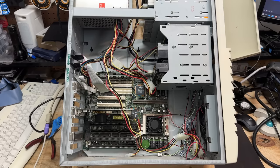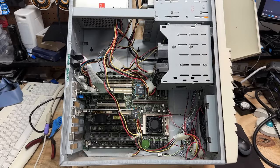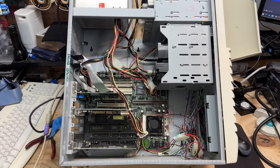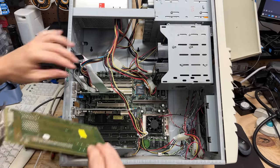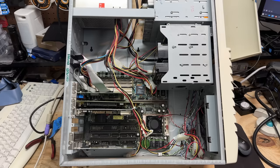I have a sneaking suspicion that it's the SCSI card — it could just be down to a dirty edge connector or something. Okay, the sound card's innocent. The NIC is also innocent. It's down to the SCSI card. I sure hope this card isn't bad. Let's just try it without the drive connected first. Okay, that's better.